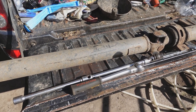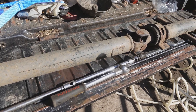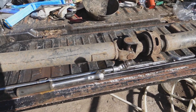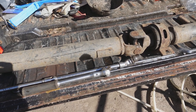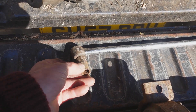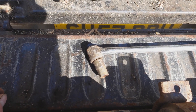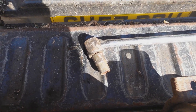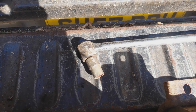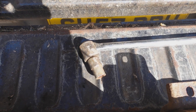At the top behind the cylinder head there are two particularly difficult ones — the shortest ones. The one on the left hand side you can manage if you get inventive with your socketry; they all have 14 millimeter heads, but the one on the right hand side is a nightmare to get at. I managed to get at it with a strong bar that can go past 90 degrees. I tried every 14 millimeter socket I had until I got one that would give me a bit of movement just to crack it. Very tight, but once it's undone you can loosen it off with your fingers. You can get a 14 millimeter combination spanner on it with the ring end, but they're so tight you just do not get the leverage to undo it with a spanner.